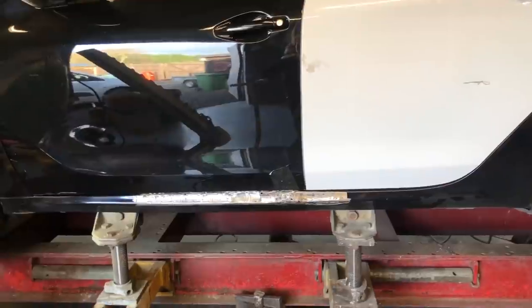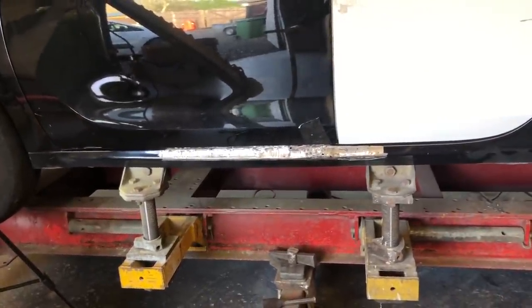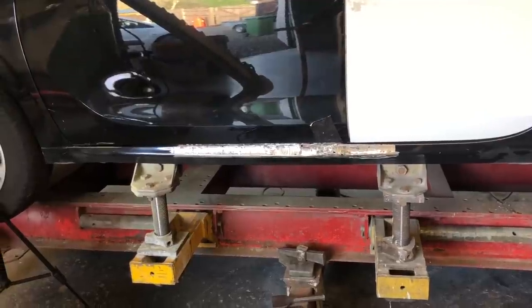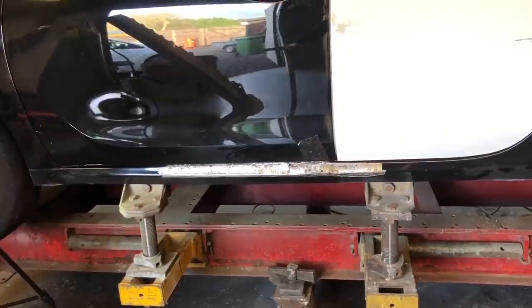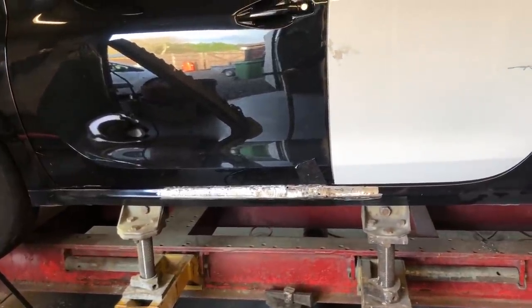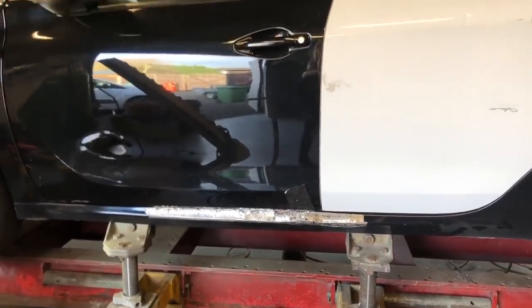He's got a couple of tiny pinholes he's got to plug up, and he's going to be welding those plates on one more time just here and here, and give that a tiny pull. Now that is actually supposed to be curved but he said he's not happy with the distance between that top line and the bottom line, so he'll pull that out, tap that up, get it about right, plug those holes up and then straight onto the filler work. A couple of people reached out in the comments asking if it's structural damage — that panel is welded on, so yes it would be a structural panel, but it's not had a hard smack, this car, and I'd be confident selling it to anybody because it's really lightly damaged and it's going to be such a nice car.